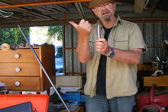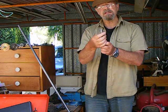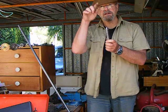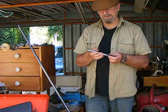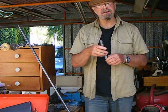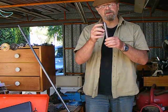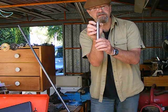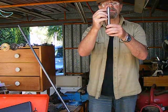If they were more, they'd stick out beyond the sleeve in some cases and may scratch the aluminium bore in the head, which would wreck the whole head — that's a thousand dollars for an aluminium blank, plus all the work involved. So you don't want them sticking out more than 21.5mm overall.